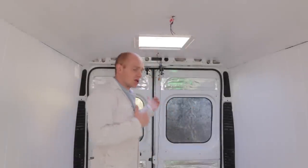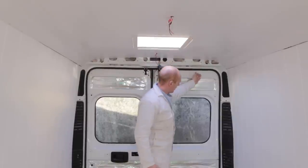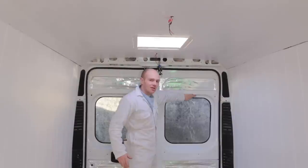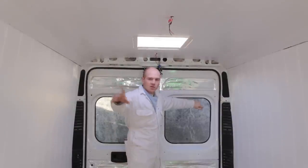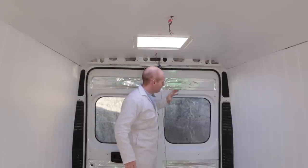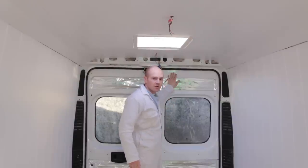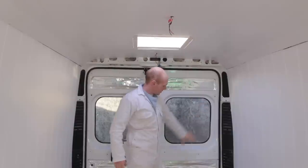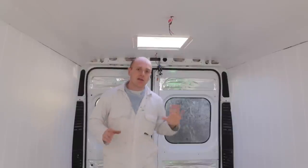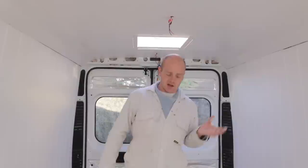Still got no idea how I'm going to do the doors. Everything has to be kept inside of those rubber seals. And because there's so much of a curve on this bodywork back into the glazing, I can't do that whole square boxed-in section because it will cut across the glazing. So I'm not quite sure how that's going to work. I probably will end up just attaching a thin plywood clad on there with the grooves in, and just leave exposed metalwork. That's not ideal, but we've got insulation on the inside of that, so it should be all right.